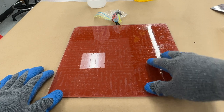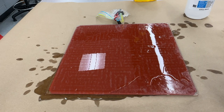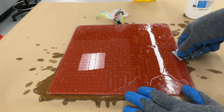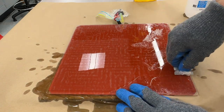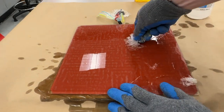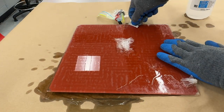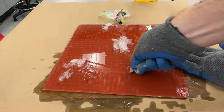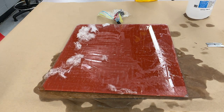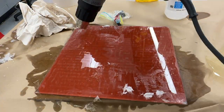Now we need to remove all of this excess adhesive. I'm going to apply some heat and isopropyl alcohol. Using a razor blade, I can work off the adhesive that's being softened by the heat and the isopropyl. Make sure that you're protecting your hands and always cutting away from yourself. If you do have a harness like I do, make sure that you're very cautious around the cable. When it starts to peel poorly, it's time to wipe off the excess, reapply heat and some new isopropyl, and keep going with multiple passes until all the adhesive has been removed.